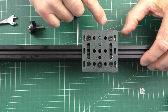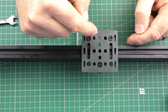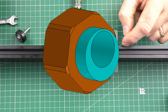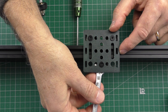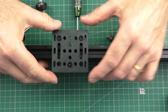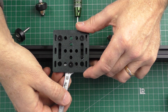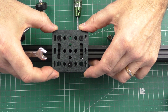That clonk clonk is the flat spots generated overnight, rotating round and ending up back where they were. If you do suffer from that you need to release the pressure on your adjusting nut — again it's just a little tweak, not even one degree at a time. At the moment this is too loose — I can wiggle it. So without looking at the nut I'm just going to move it. Now that's much better.